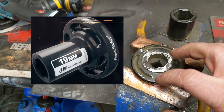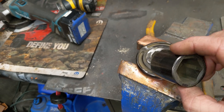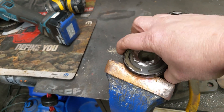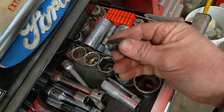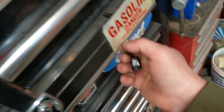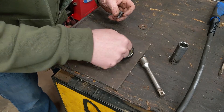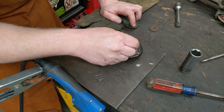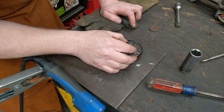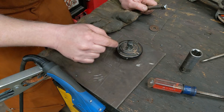You can see inside — nothing special about this at all. Funny thing is their photos show it looking way nicer; the socket really isn't any thicker than a regular socket. I already have the female part, I just need the male part — found one in the toolbox. There's about a 3/16" gap all the way around, so I'll just build up the inside with a little weld. After about three passes around, I'll set that on there, make sure it's centered, put the socket on it to make sure it's straight, and weld a bead around the bottom.